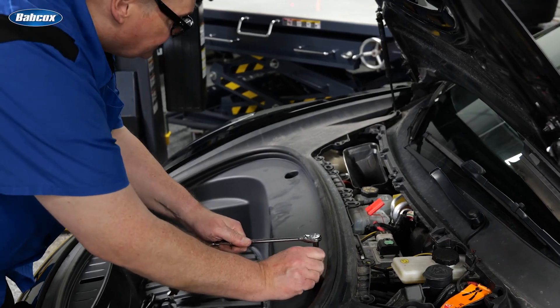But now you can gain access to the 12-volt battery. Open the hood and remove the trim panel that covers the low-voltage battery. Locate the battery post and the appropriate positive and negative terminals. Attach these, making sure you do the positive first and then negative. You should now be able to charge and jump the low-voltage battery and power on the ignition to gain access to the vehicle.